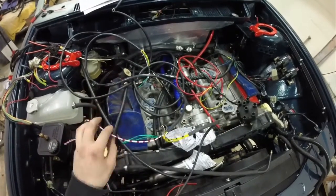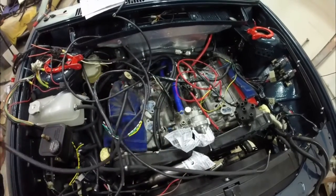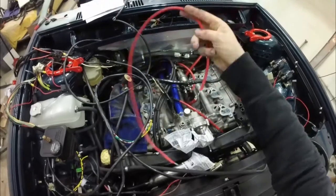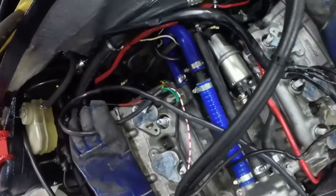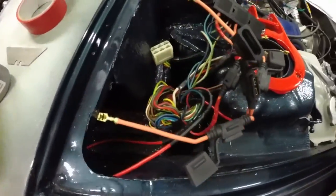Since most of the wiring was rerouted and the battery moved to the back, connection points have been placed at the front for emergency access, in case required. This wiring came with a lot of issues, so most of the engine bay harness has been rewired. Wires attached to sensors have been grouped in a specific manner and relocated in areas where it would be possible to access them without having to dismantle half the engine in order to reach them.